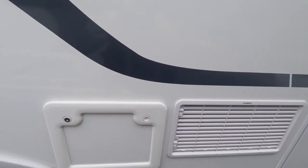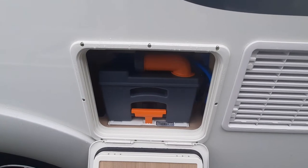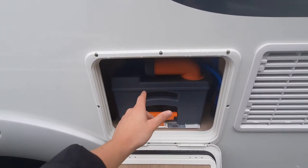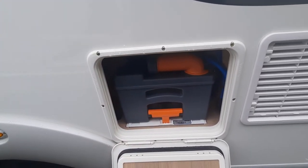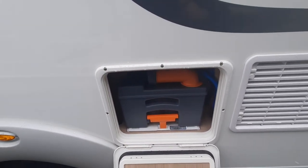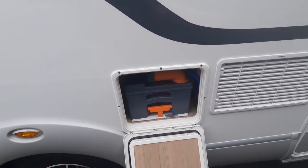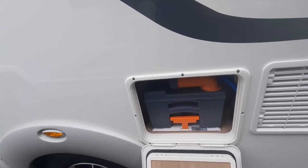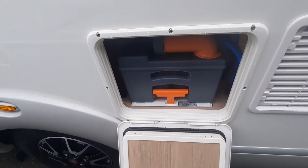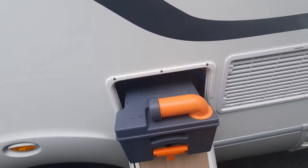Next, you've got your toilet cassette, which is just in there. Once opened up you can see the cassette. When removing this, the main thing you need to make sure is that the blade on the toilet is closed. If the blade is open and you pull and force it out, you'll snap the arm. As a rule of thumb, if it feels like it's being forced — and this goes for everything in the vehicle — you're probably doing something wrong. So make sure you shut that blade, which you should after every use, and then simply remove — slide out and then you can remove it.